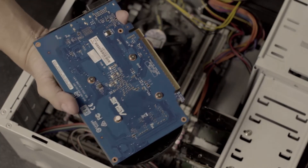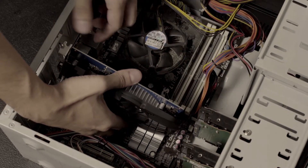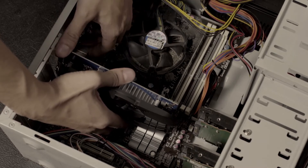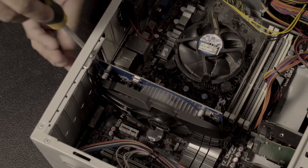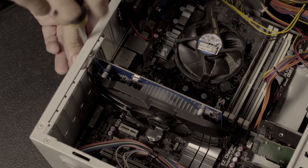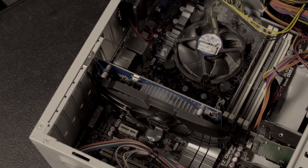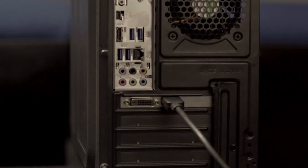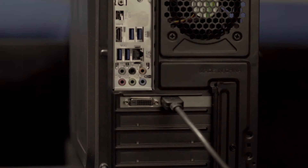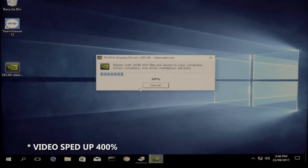For our system, we have one free PCI Express slot. You should have a minimum 300W system power supply and at least 350MB of available hard disk space for your drivers. Then you have to secure the card with a standard screw. Once we've replaced the chassis cover of your PC, you can now connect your monitor cable. This has an HDMI 2.0 port, so you can connect the HDMI cable directly.